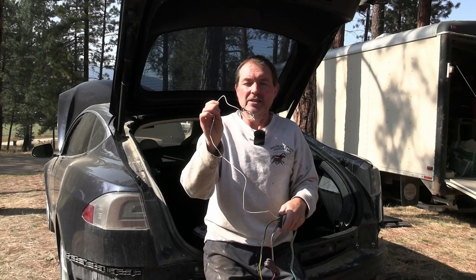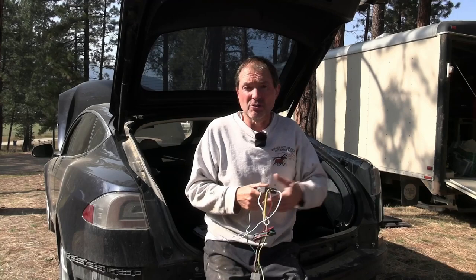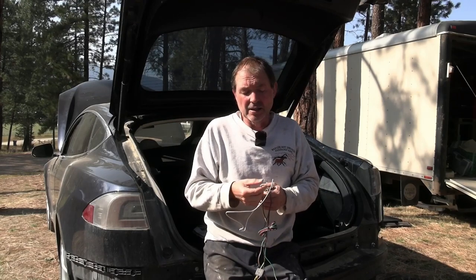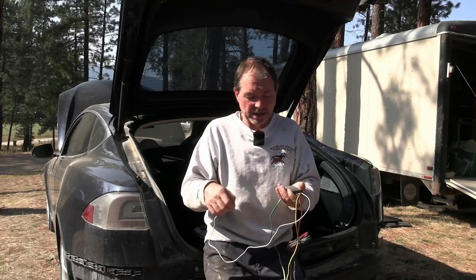And one more thing we have to do is a ground. So it's got to get a ground somewhere. And I know the Model S has a couple grounds here in the back, where you can just undo a nut and put that over the stud and put the nut back on.